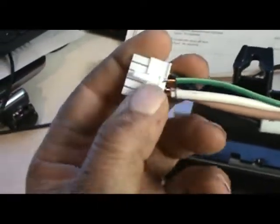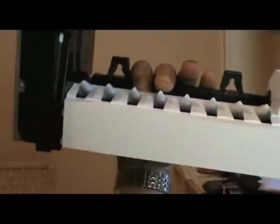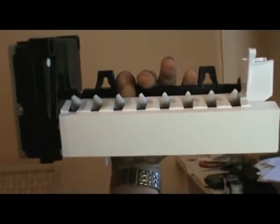There's a little lock here. You plug it in there into the five pin connector in the freezer, then hang it on the wall. The ice maker is already hanging on the wall on these two hangers — tighten the screws. Now there's an adjuster down here. I'm going to be honest with you — I don't ever put these on, because if the refrigerator is level, the ice maker is level. This is for leveling up the ice maker in case the refrigerator is not level. But get the refrigerator level and you won't have to worry about this.